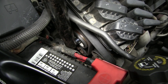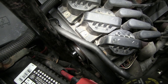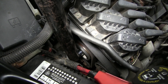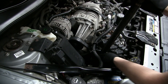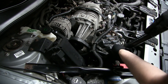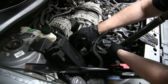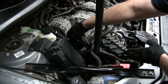To release the belt we have to release the tension off of it. Here's the tensioner pulley — it's about under your middle coil. I've got the 15 millimeter socket on there with the ratchet and my breaker bar, and I'm gonna go ahead and crank this clockwise to release the belt. Take note of how the belt was on here when you're taking it off so you know how it's gonna go back on.